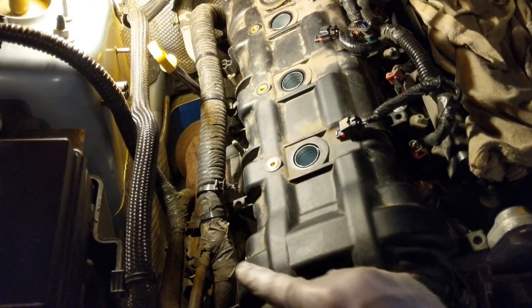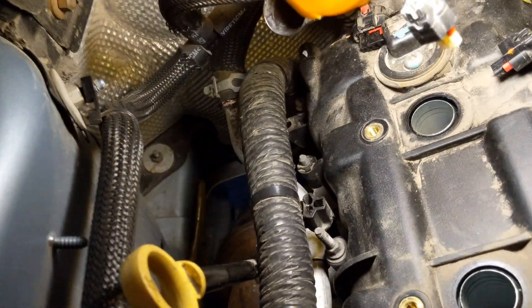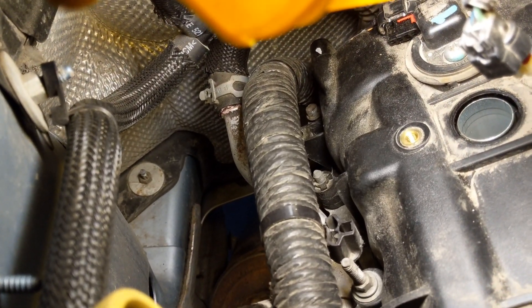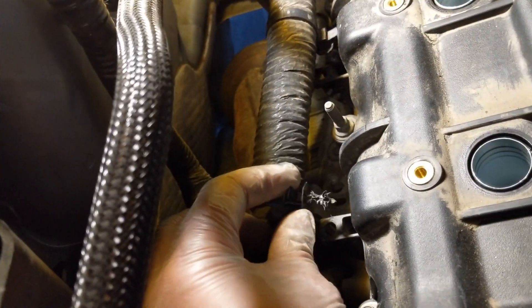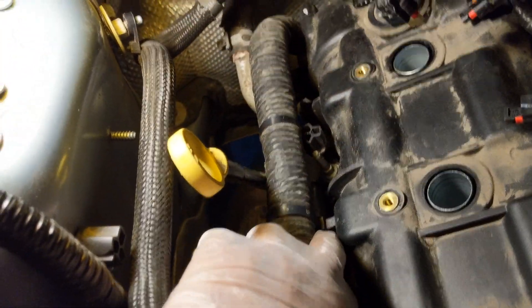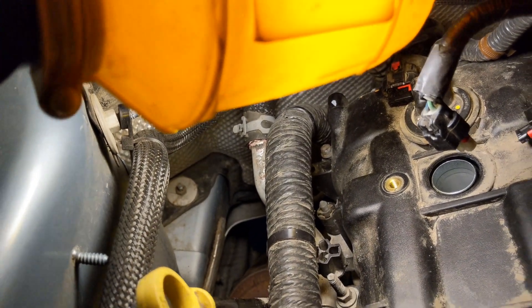I got the coils off and I'm starting to take the screws off the head, but there's this tube with one bolt in the back that is nearly impossible to get to with the tube in the way. You're going to have to undo some more of these Christmas tree type connectors off this tube. If anybody has a trick for getting those off easily without breaking them, please share it in the comments — Chrysler absolutely loves those on this engine. You'll have to loosen up that tube to get at the back nut to take the head off.